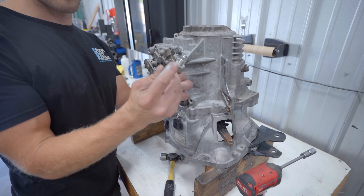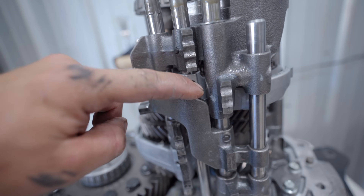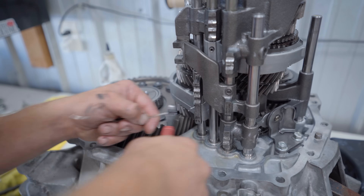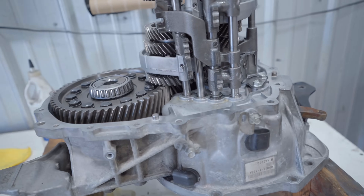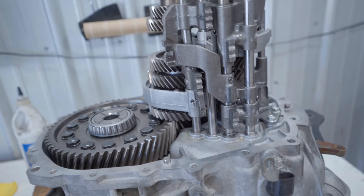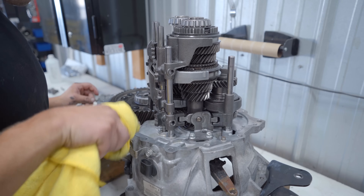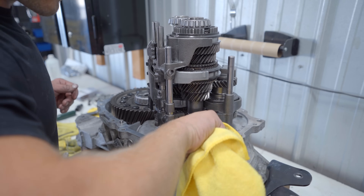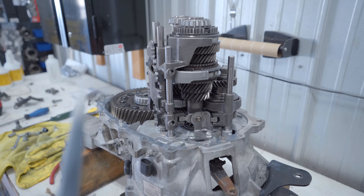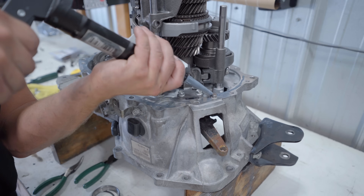One more light mod — I'm going to safety wire that roll pin there and that roll pin there. Let's get this thing cleaned up and sealed. I'll be using the good old 3-Bond 1217H, pretty much what I use on everything. I'll get that case on and we have a transmission. Microfiber and a good shot of brake cleaner — last thing we want is our brand new transmission leaking oil. I'm so excited to drive this thing again, especially with this new final drive. If you're not applying your RTV with an applicator like this, you should — it makes it so much easier. A nice, consistent, even bead around the whole outer perimeter.